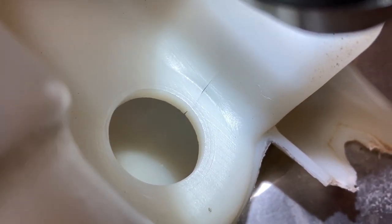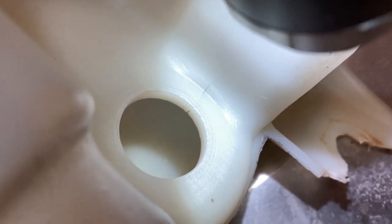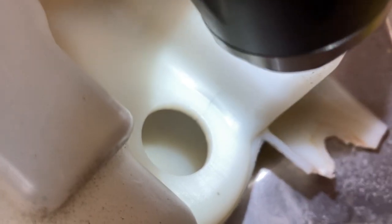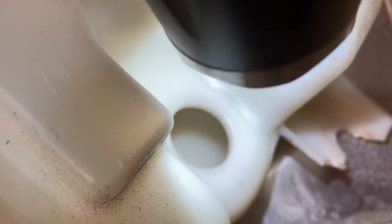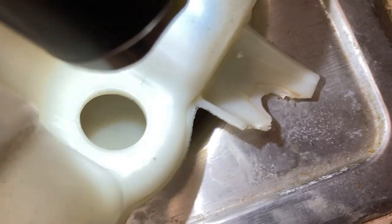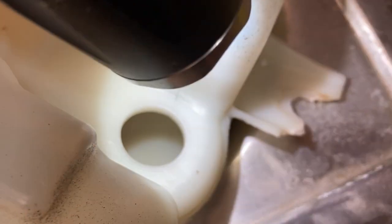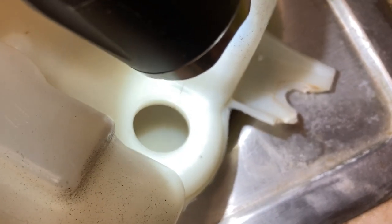So if you try to change the bulbs, which is a really terrible thing, probably your best bet is just to take the battery off the driver's side out and take the tray out and change the bulbs, and you'll have enough room to change the bulbs. Otherwise, what you probably need to do is come in here and just clip it. Just clip it right there before you do something like this. And this is ridiculous, to have the wheel well hooked up right there with a clip. It really should be one of those push things.